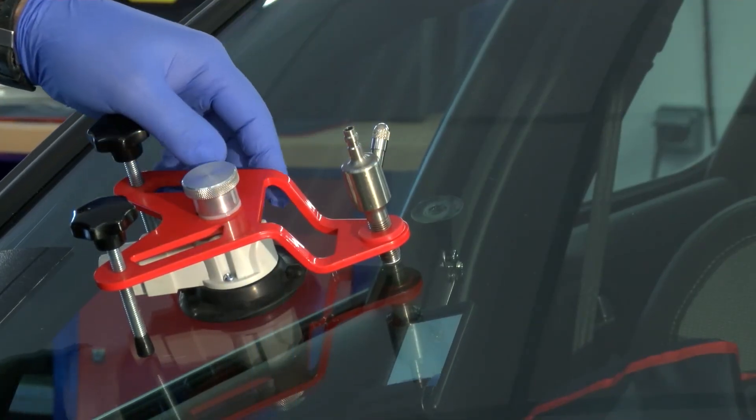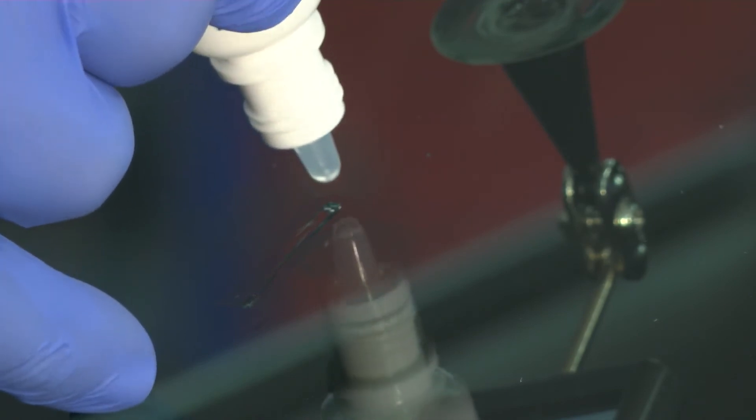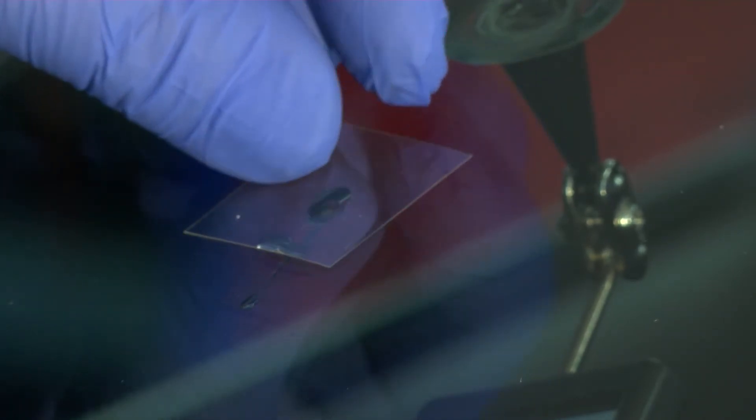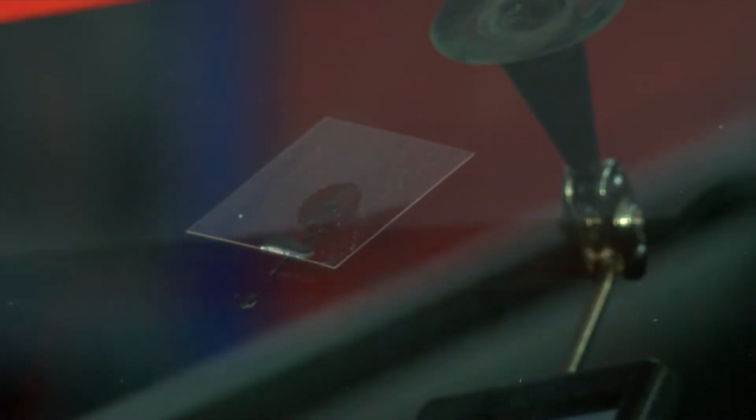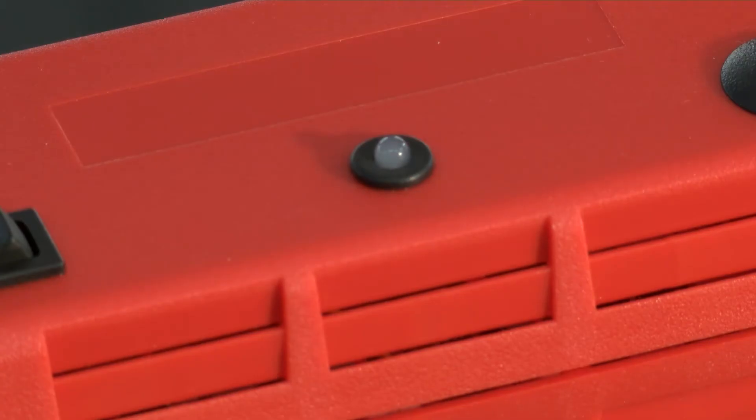Remove the injection bridge. Remove the excess injection resin and apply the pit finish resin to recover the pit. Apply the mylar square to be covered by the resin. Cure the resin with the UV LED lamp for 50 seconds. For the classic bulb version, the curing time will be extended. Curing of the resin is complete once you see a slowing down of the flashing diode.